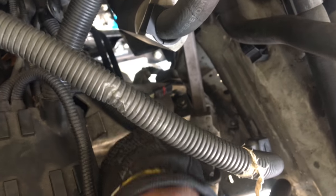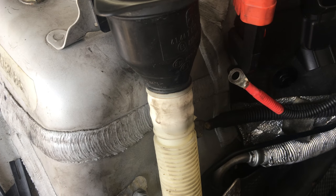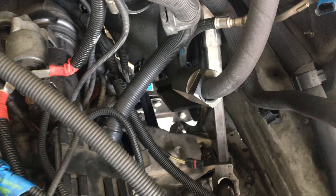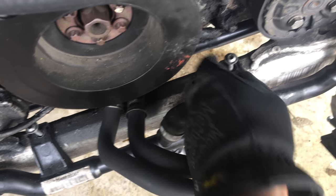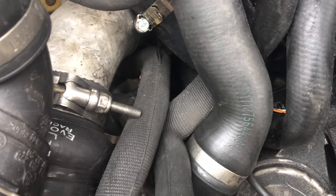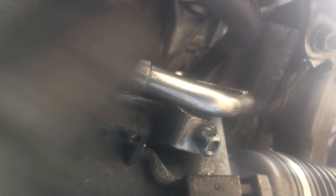Now I'm going to start taking off this ground right here — it runs pretty much from the mount all the way over to the chassis. I'll take it off with a 13mm. Then there's another ground right here — I'll take that off with a 10mm. Take these two grounds off and we're almost in the home stretch. Then I'm going to unbolt this line off the chassis so it can come off with the engine — it's a T27 on these. Just take these out and this should come off with the engine. It pretty much routes all the way over to the water pump and thermostat connection.